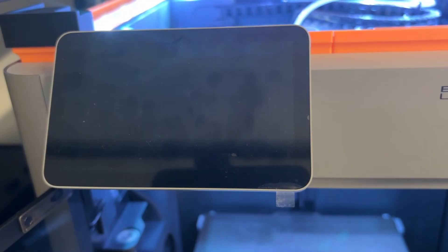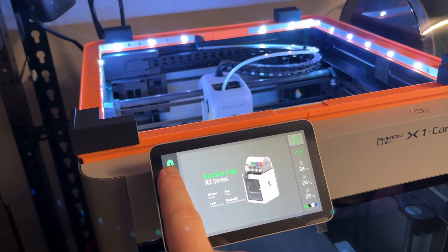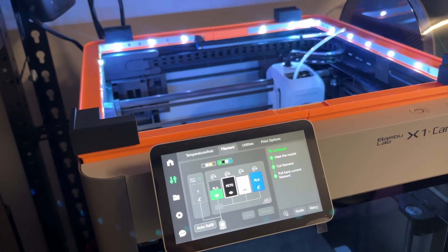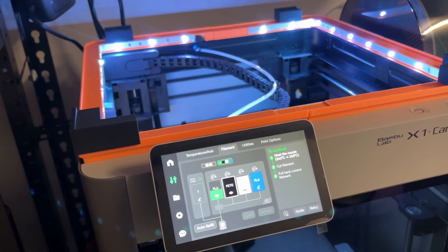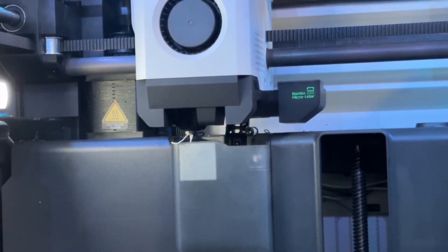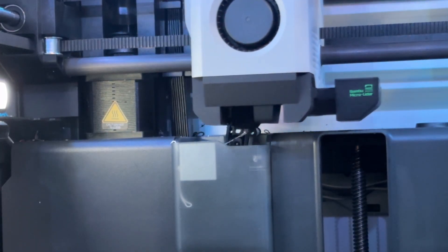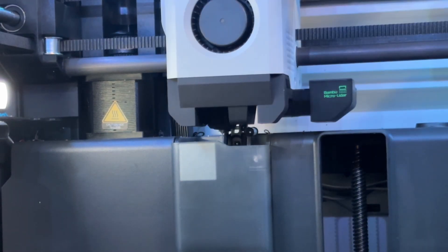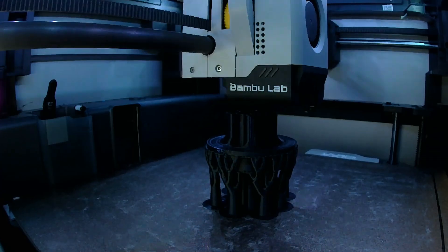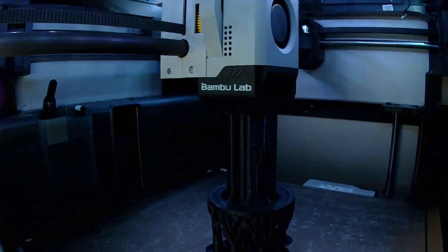It's probably a good idea to power cycle your machine at this point — simply turn it off and then back on and wait for it to boot up. Once booted, go to the printer settings, go to the filament tab, and you might need to unload the current filament by selecting it and clicking unload. It will heat up the nozzle and retract the filament. To test that everything's working, click on a filament and load it — it will heat up, push the filament through, and if everything's working correctly you should see the filament start extruding through the nozzle. All in all, it's not a hugely difficult process. It may look complicated with all the screws and cables, but this should only take about 20 minutes. I hope you've learned something — if you found value in this video, please consider subscribing and liking. Until next time, thanks for watching.